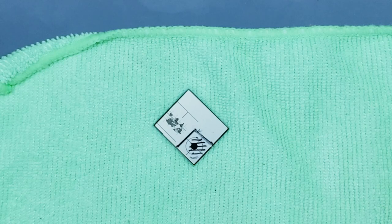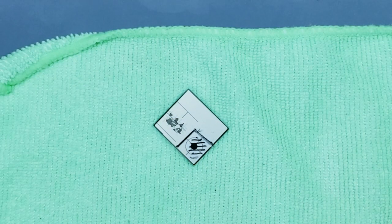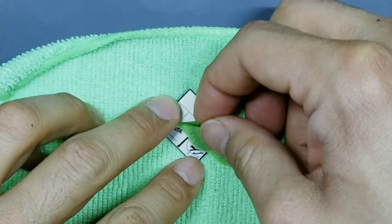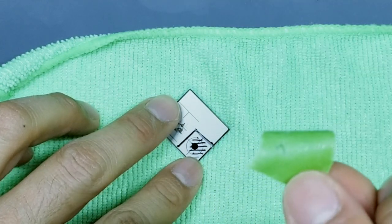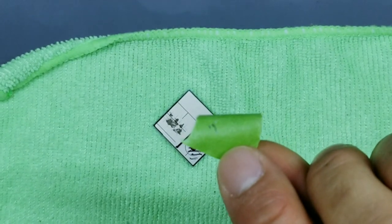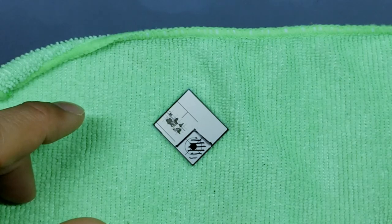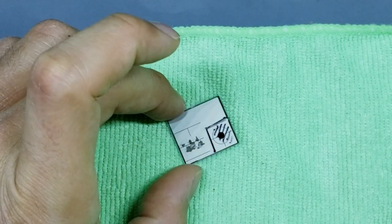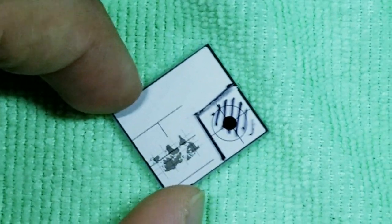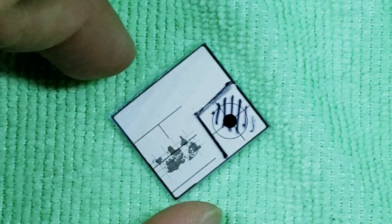Recap your knife. Take a very small amount of tape, if you have it, or anything sticky. Put this right over where you just cut. Press it in and then lift up gently. What we're trying to do is remove that debris with the tape, so that debris doesn't start getting pressed into the good part of the display and scratch that portion. Set your tape down to the side. We're going to turn this to the other side now, and cut one more time.